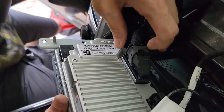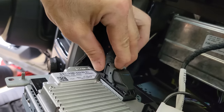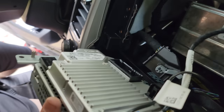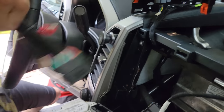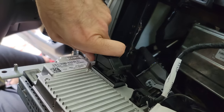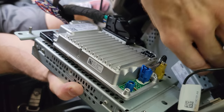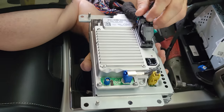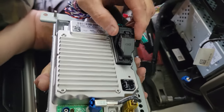The first thing we're going to want to do is remove this connector right here. You want to depress this button in the middle and simultaneously work that latch forward — push and pull right out. One of the connectors that you get in the kit is this T-harness, and you are going to plug this into the back of the A-pin with the same lever action. Make sure you push firmly all the way down until it latches securely.